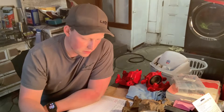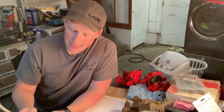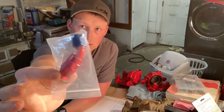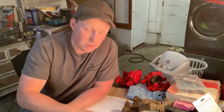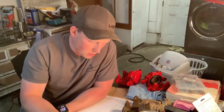I want to talk about the fuel system today. I bought a 20-foot TT Racing 6AN braided hose with a PTFE liner inside. It came with 10 hose ends — I got two 45-degree fittings, two others, and four straight fittings. I used six fittings total: one 90-degree, one 45-degree, and four straights.